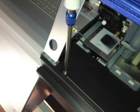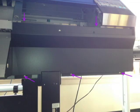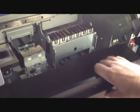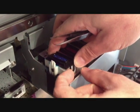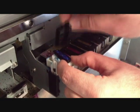Now we need to open the front cover by removing five screws located in these areas. Gently pull forward on the cover, revealing the pumps and the hoses to the cap tops. The caps are spring loaded. We need to gently remove the cap cover, being careful not to drop the inner springs.